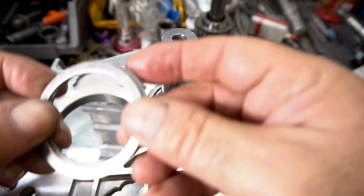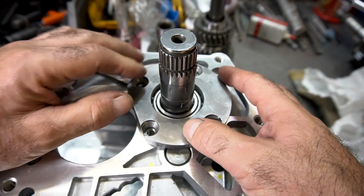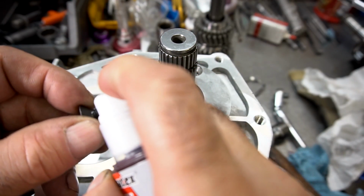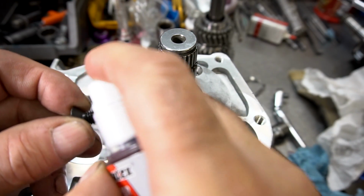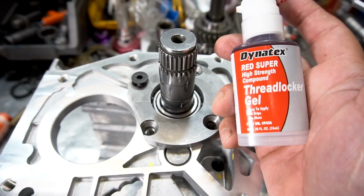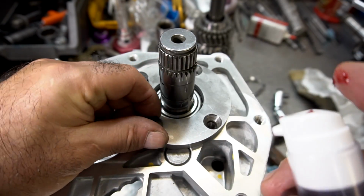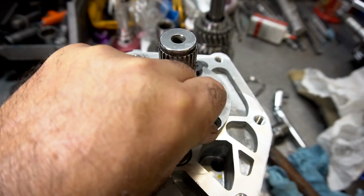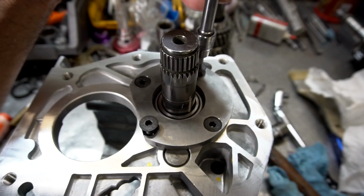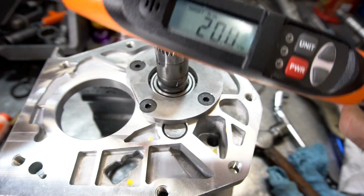We're going to put our peelable shims in place. Laid a stabilizer plate on here. This is a product of mine. Some of these new bolts, and these bolts are 8mm threads by 20mm length. I use this kind of pump type thread locker. It doesn't run. It's kind of like a gel, like the sealant. I torqued these to 20 foot-pounds.